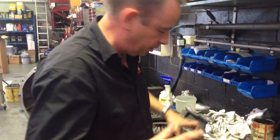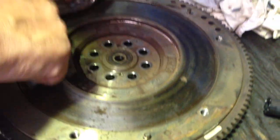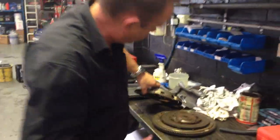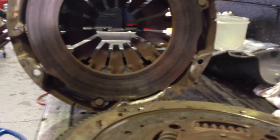On this brand new one you can see the grooves, which indicates just how badly worn the old one is. On the friction surface you'll see these heat spots — they're not as bad as what I've seen on other cars, but they're caused by loading up the clutch too much or putting too much heat through it. The cover plate is very similar. Hopefully this has helped you learn a bit more about your Subaru — you can contact us on Facebook, YouTube, Twitter, and Instagram, send us an email, or give us a call. We're here in Sydney, Australia, but wherever you are in the world, thanks for watching.